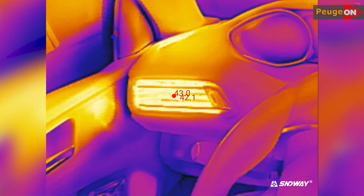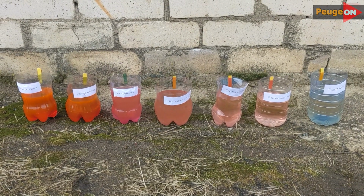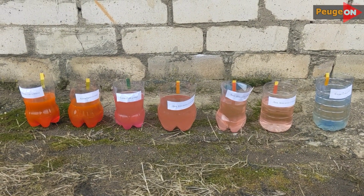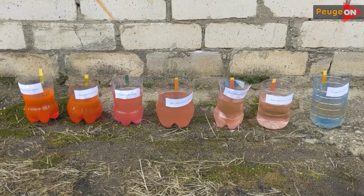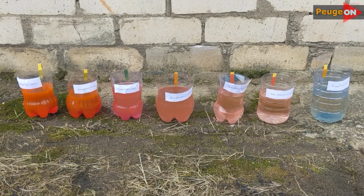Also, I would recommend rinsing with acid, not 3 times, but probably 4. It will be even cleaner that way. But this is all individual. And in conclusion, a bit more visual information so you can understand how dirty your cooling system is. I remind you, the mileage is a little over 200,000 if we trust it. The antifreeze is clear, with no films, dirt, or anything like that floating around. The heater and climate control work properly, or at least that's what I thought.